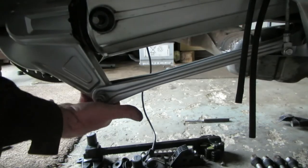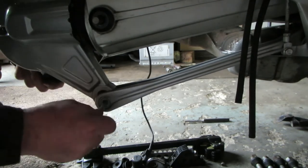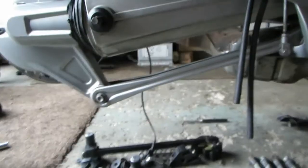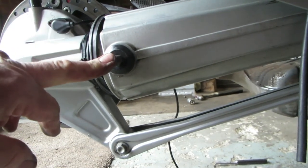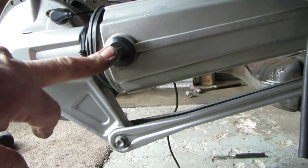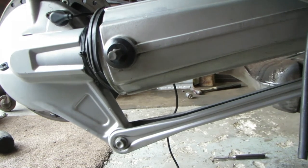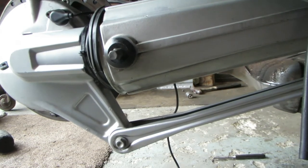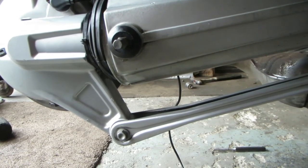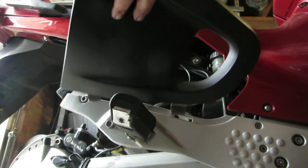Now just to make sure, remove this bolt so you can confirm that they're actually in position. Put the bolt back in. Now do everything back up - do this up to about 140 Newton-metres, but look the torque setting up in your book. I'm not going to tell you what the torque setting is. Do this up to about 140 Newton-metres and the one on the other side has to be done up to about seven Newton-metres. There's lots of grief and loads of people have different ideas what it should be, so look in the book and make your own decisions about that.